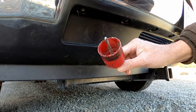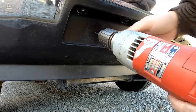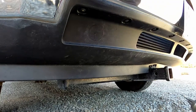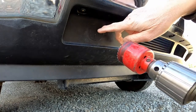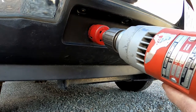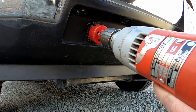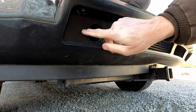I'm using an eighth-inch pilot hole because the drill in the center of the hole saw is quarter inch, and I know it's going to want to drift a little bit. That may be a little low, but that's good to know. Now that I've got my pilot hole drilled, I can bring in the pilot for the hole saw. I'll drill this pretty slow — I'm not too far off and I can raise it up a little bit, nice and slow. This is plastic after all. Actually that looks pretty clean.